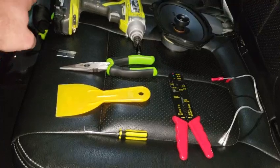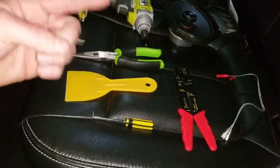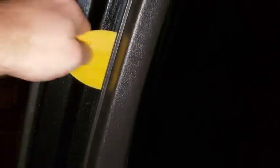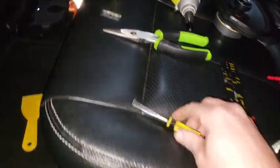All right guys, we're back — passenger side. Here are all the tools I used on the other side: my drill with three socket sizes, needle nose, razor blade for cutting the wire loom around the speaker wires, and a spatula which actually worked great for taking the panel off. So panels off and there's your one bolt right here — just two clips holding it.